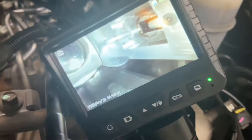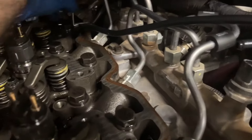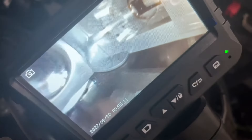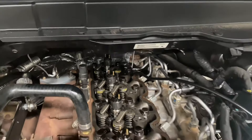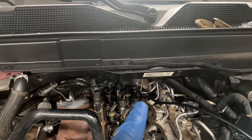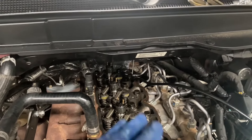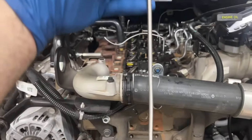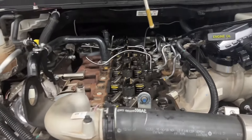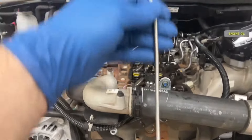The lifter was successfully lifted up into the bore for exhaust number six. This is just about how much play you want — very slight, barely visible on camera. You don't want it so tight that the magnet may break loose and drop the lifter into the oil pan. You want a little bit of play; the cam will be fine going in. This is something you need to get a feel for before doing the actual install — you can practice in the front.